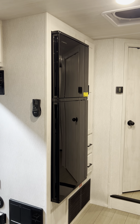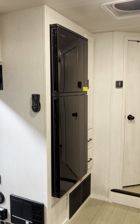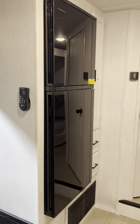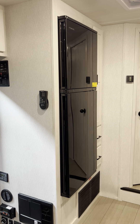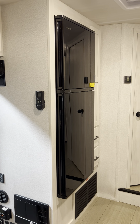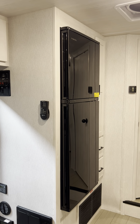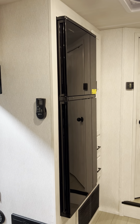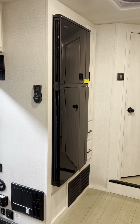Prior to your arrival — or if you're getting the RV the day before because you want to get it organized, no problem, you can do that yourselves — but do not put food in the fridge until it's properly cooled down. The reason is the compressor has to work even harder because it now has to cool itself down and cool down your food as well. I've heard many cases where the fridge breaks, and these things are not cheap. But love the 12 volt fridge!